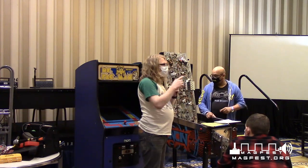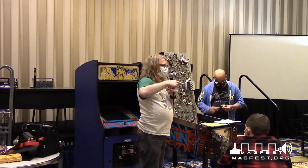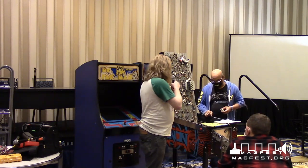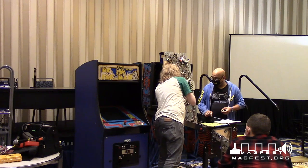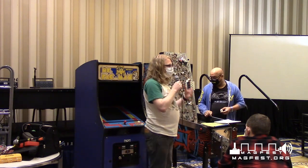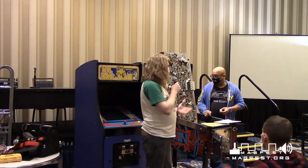Under this paper is a winding like you would see in a transformer. So the winding is a coil of insulated wire that has a certain number of turns. This one is a 26-1200, so it has 1200 turns on it. And that's an important number to remember.